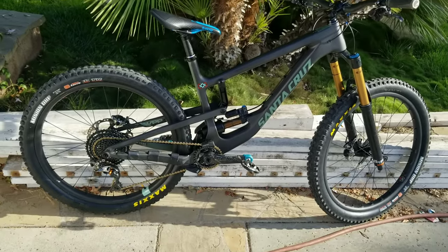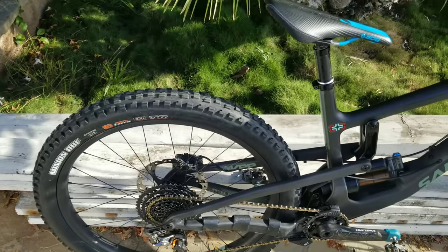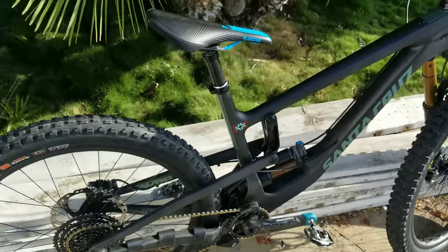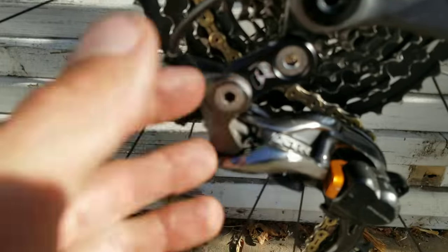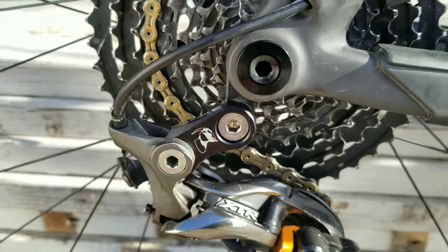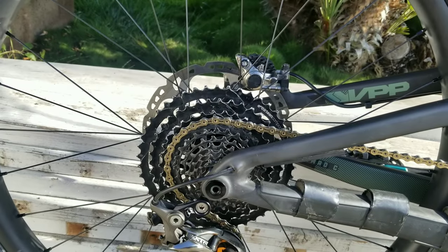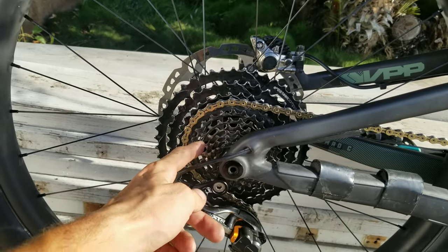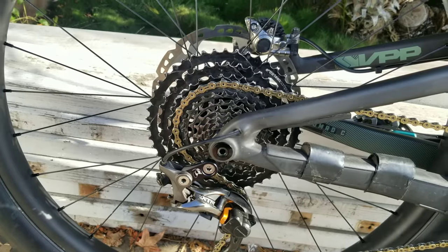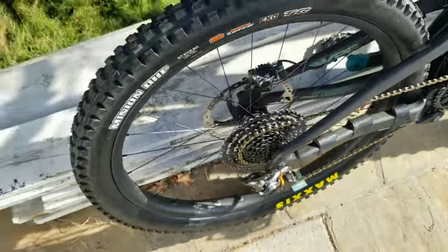Got it all wrapped up — wheels installed, shifting is tuned, brakes all aligned as they should be. And I put this goat link on — hey look, it's got a goat on there. If anyone out there is running Shimano everything with an E13 cassette and it doesn't shift well, especially into the second-to-last gear, this goat link just made my life way better. I cannot believe how much it improved shifting. Tires are ridiculously wide — we'll see how that goes. Get the Cushcore on, any questions let me know.